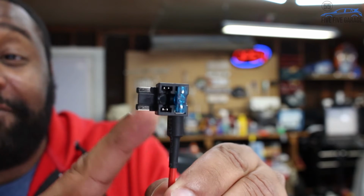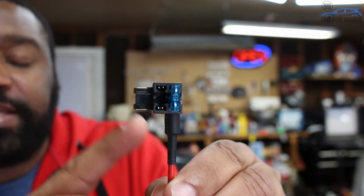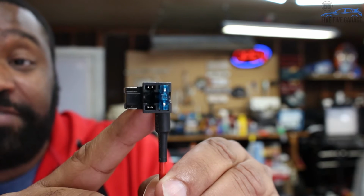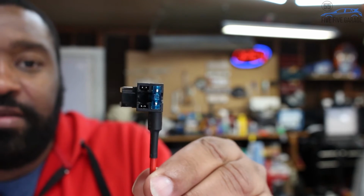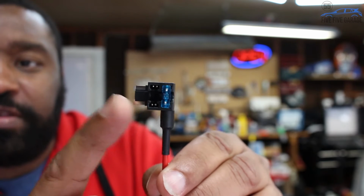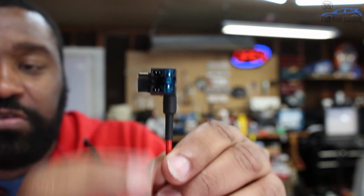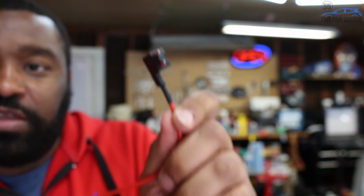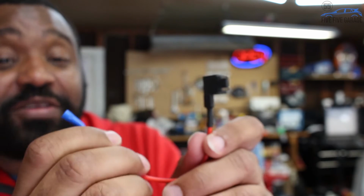The other ones will not fit, so make sure if you're going to order these, and I'll leave a link down in the description to these as well, but make sure you get these specific ones or they will not fit. And basically it has the fuse block where you put the fuse for the original circuit that you're going to replace with the new fuse, and it already has the crimp on the other. You just unplug the fuse from the fuse box, plug this in its place, put the other one in, and you run your lines to it.